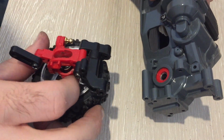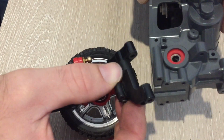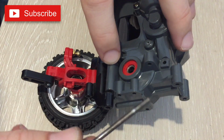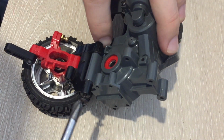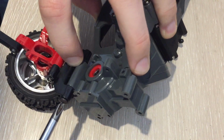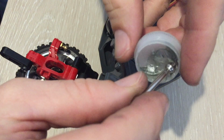It's just a matter of attaching the suspension components. I've given these a bit of a clean. They go on pretty simply. They just slide into the chassis section here. You've got your pins, which go through here, through the chassis component, and then screw these onto the car. And obviously we've got our front dog bones. Just put a little bit of anti-wear grease on those.